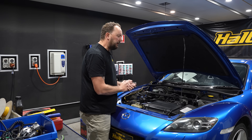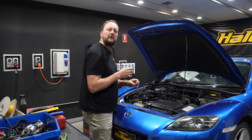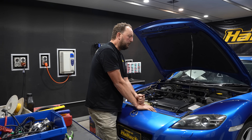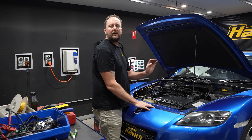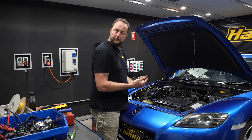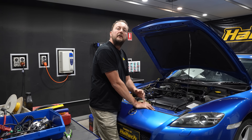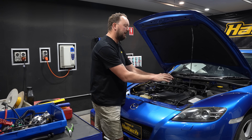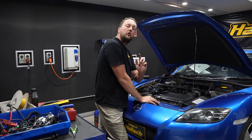Here's a handy hint. If you've got your car on the dyno with the front wheels stationary but the rear wheels spinning, a lot of late model ABS units will get a little bit cranky. You can press the ABS or traction control button to disable it — though it doesn't always work. You can press and hold for 10 seconds to disable stability control and ABS — also doesn't always work. You can Google various button combinations. Or, on some cars like this one, you can simply unplug the ABS unit while it's on the dyno. Yes, you'll have a few warning lights and you won't get CAN-based wheel speed sensors into the ECU, but there'll be no stability control interference on the dyno. Works on the Mazda RX-8 and could work on many late model cars.